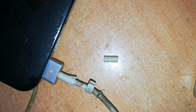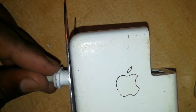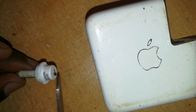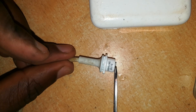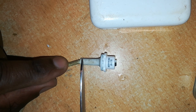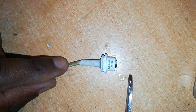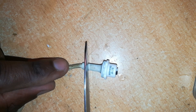Always do that so that you do not waste time repairing something which doesn't work in the end. With the charger open, cut off the cable. Hold the wires from behind the junction, then remove this junction — we'll use it again. If you want to know how to prepare these junctions so that you can reuse them, I'll show you that in another video. Otherwise you can watch my previous videos about repairing the rubber junction.